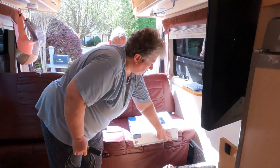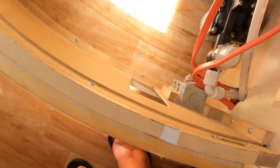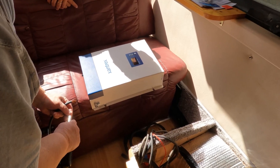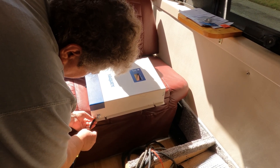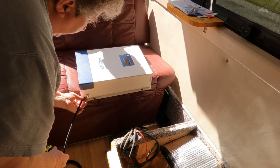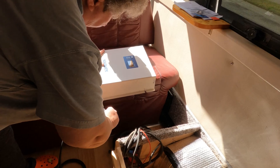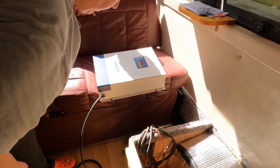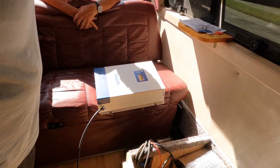We've cut some notches here to make it easier — we're gonna put screws and then slide it down. First I have to install a case ground that will go to the negative bus bar. This is just a protection in case something is wrong with the wiring — it keeps the case from getting electrified so it won't shock you. You always want a case ground for protection. Xantrex really goes out of their way to make their units look nice — the battery looks great.